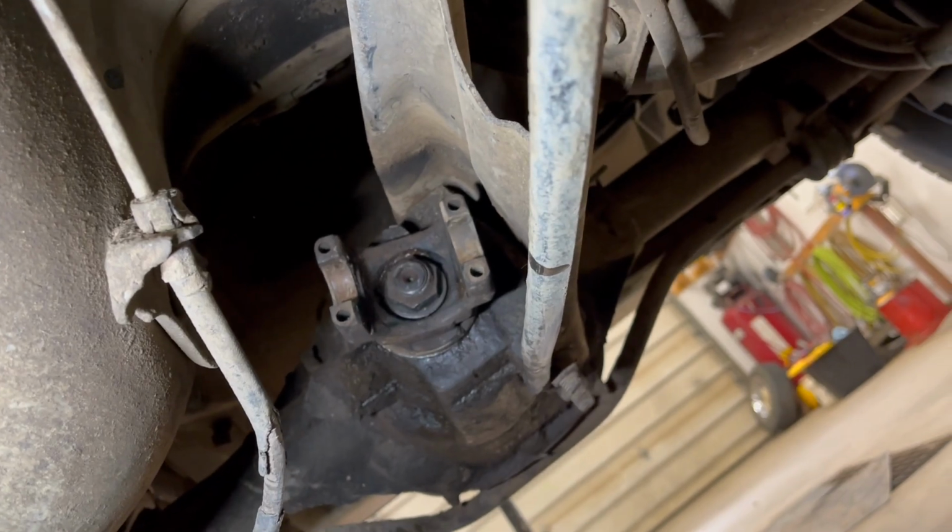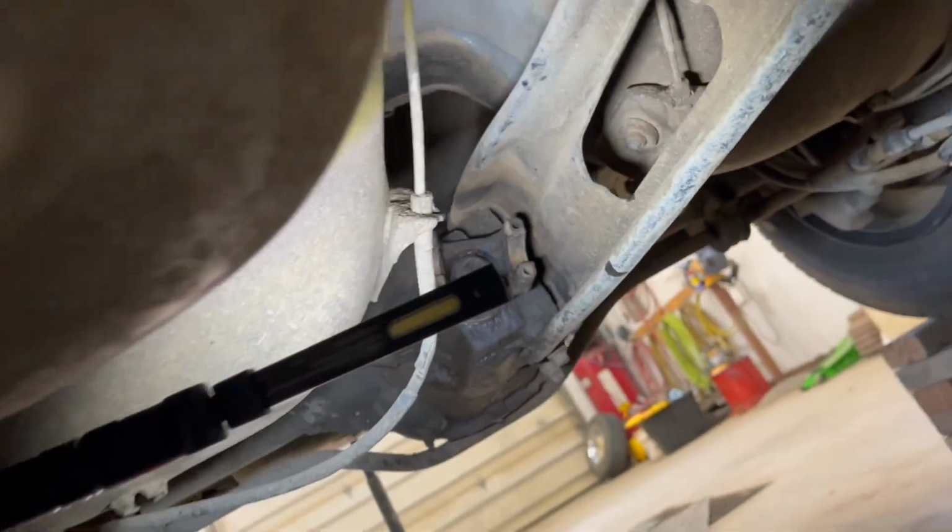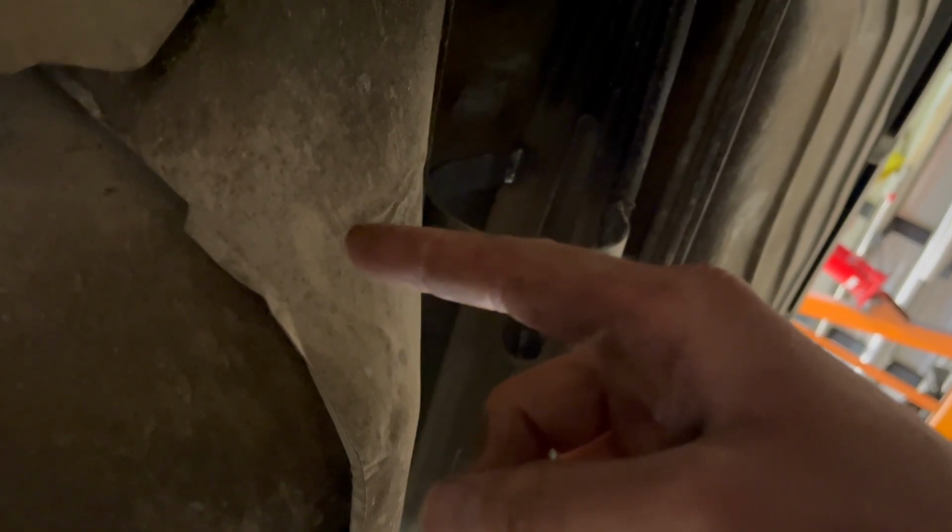I'm actually gonna pull my torque arm assembly out, and I'm gonna do a Hawks performance one. That'll actually have like a cross member back here. That'll integrate in to my subframe connector, so mount to those. So I'll make it so it bolts on or something, I'll figure it out. And then that torque arm will mount somewhere in the ballpark of back here. Because of the 4L80, it's just tight tolerances up there.